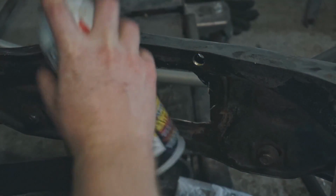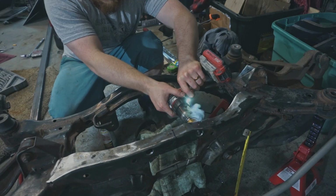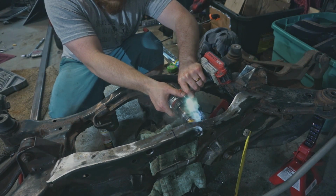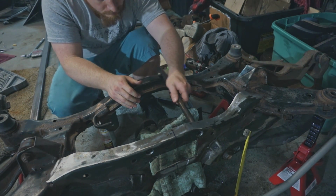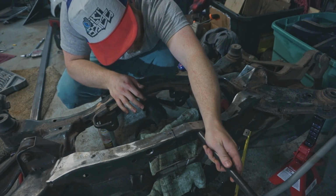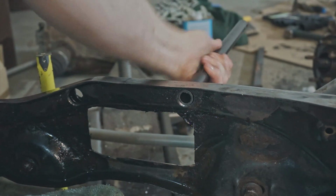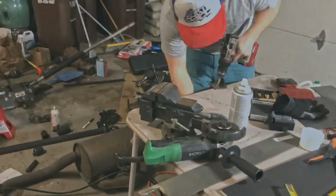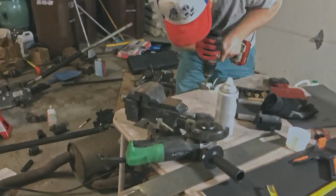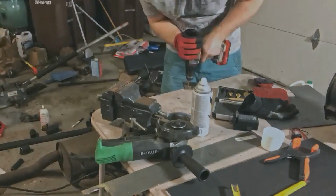I'm planning on doing a similar style of just studs. The subframe is just stamped steel that's welded together, and you can't bolt through that without crushing it. And so I drilled a couple holes in the subframe, and I can run this piece of DOM steel tubing through it and then bolt between it, and it won't crush. So my thinking was just to find the center line of everything and line up the centers and then weld it in place.